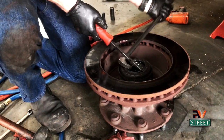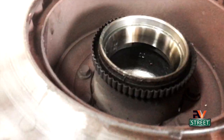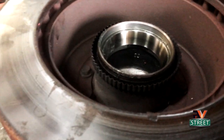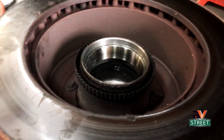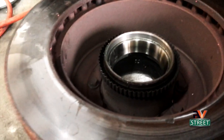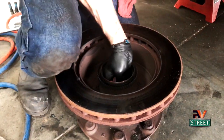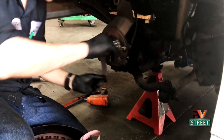We're looking at the inner race right here and from this point it looks really good. I see a tiny discoloration there but that's pretty normal wear. When we pull these off to repack them we're certainly going to inspect them closely and make sure they're within spec. He said if they need to be replaced we'll replace them, but from what I'm seeing I don't think they'll need replacing. He's cleaning the inner race in the hub area. The races are good, the bearings are good, and he's taking some emery cloth and lightly polishing the spindle.